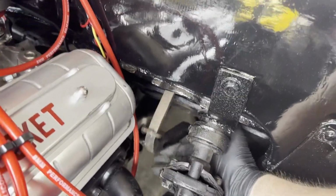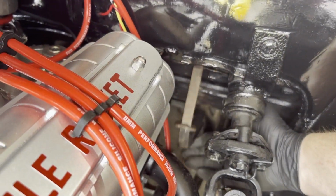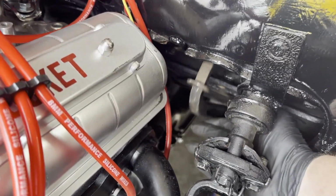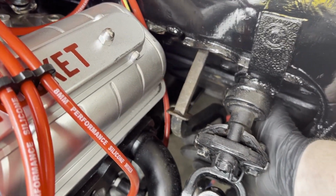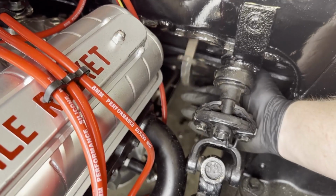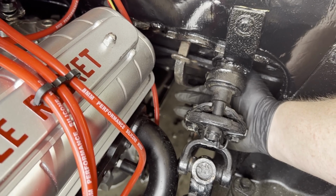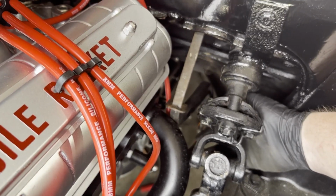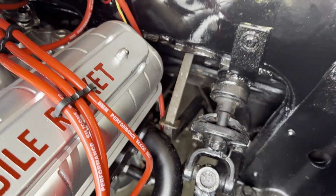Heat and some bending, as you can tell now, it clears the block, no problem. The brake should be fully engaged before it hits the exhaust. So we're in business. Let's pull all this off. I'll oil the shaft in there, put the new snap rings in, and this should be good to go.